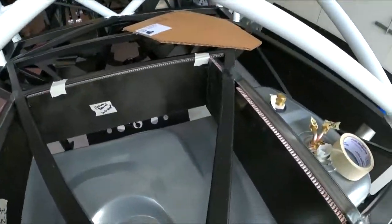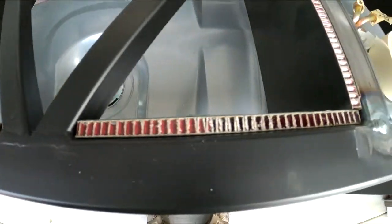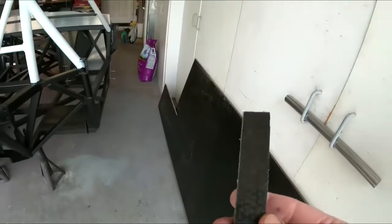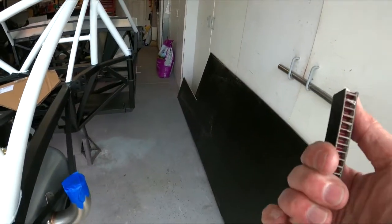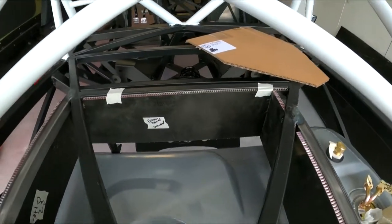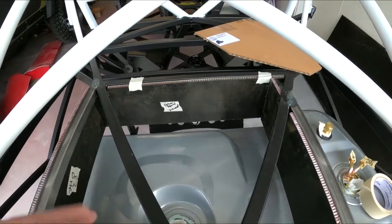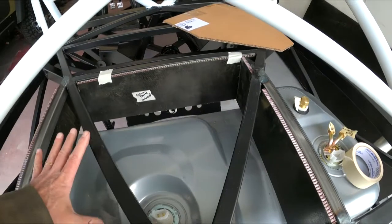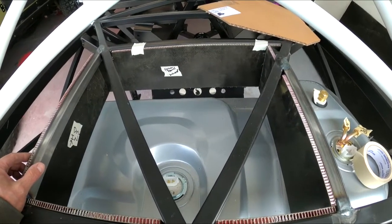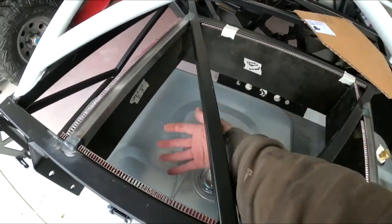We got the box done. As you can see, all carbon fiber. You can actually see the honeycomb — pretty thin but it is strong. Take this small little piece here and try to bust it and it just doesn't bend, doesn't flex. It's strong. So what we'll do now is cut a piece to fit the inside — that'll be the floor — and then we'll glass that thing and drop the fuel tank. We'll probably screw this thing in, then glass it in place and drop the whole thing out to finish laying up layers of fiberglass. Just fiberglass — this thing should be a nice little storage area.